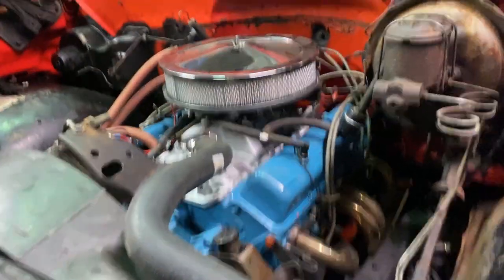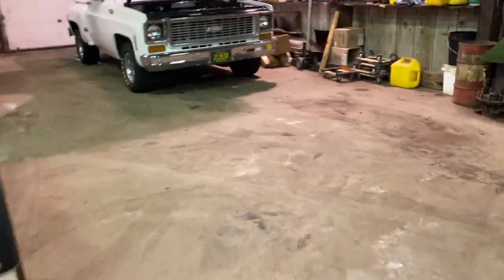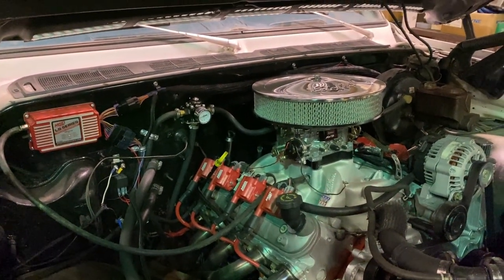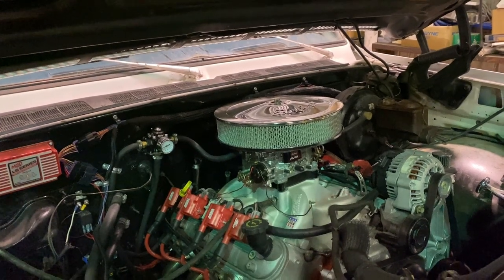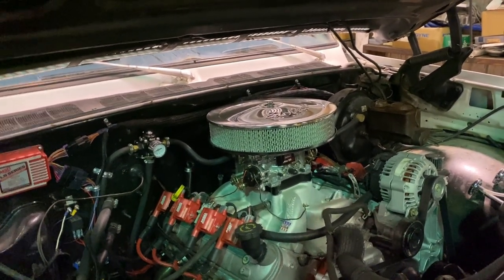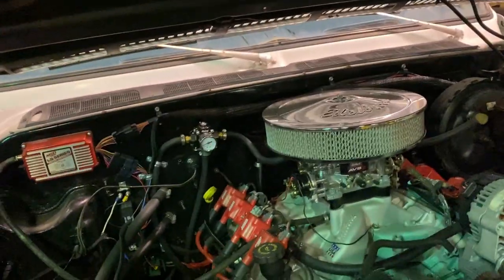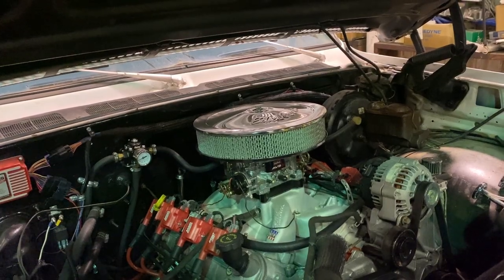Stay tuned — we've got the LS truck to work on. The LS truck is getting a cam swap; I'm putting in a Texas Speed V4 Torker cam, then probably doing some retuning on the carburetor once it's in. It should be a pretty nasty cam, should put me somewhere around 600-650 crank horsepower. I've seen a 5.7 liter LS1 make 658 horsepower, granted it was fuel injection. With this intake I know I won't make that number, but if I can find a single plane Edelbrock Super Victor intake when I do the cam swap it should make that power if not more.